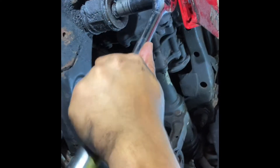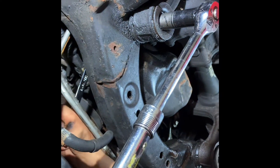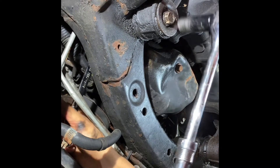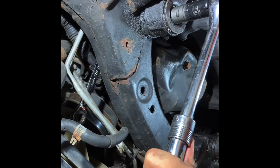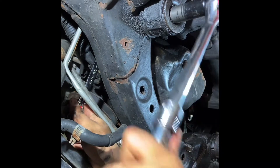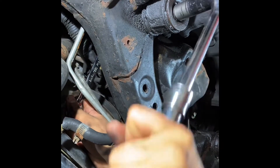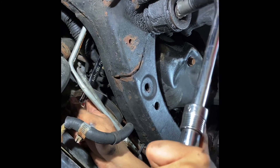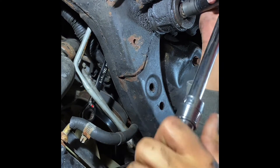Okay, let's try this again. This is a cleaner car, and usually if you're in the rust belt, where we are, unfortunately this could be a lot more difficult than what it really was. All we're doing here is taking off the top nut, strapping these bolts, installing the spacer, reinstalling the bolt, and that is it.